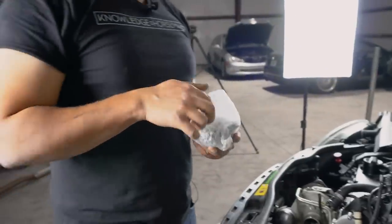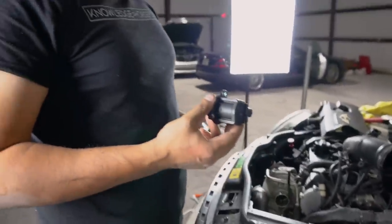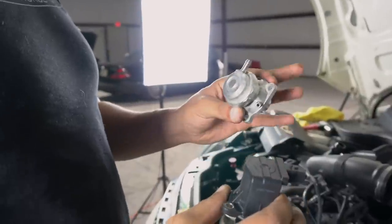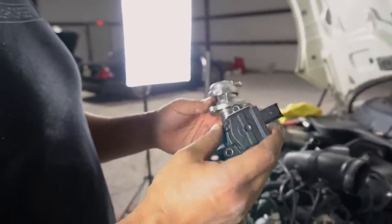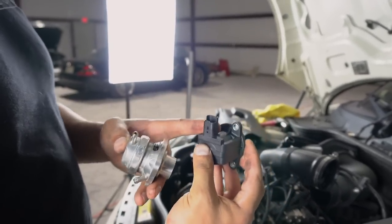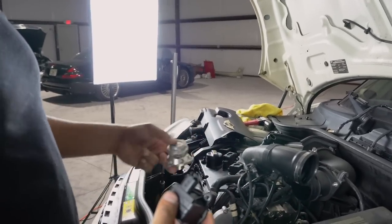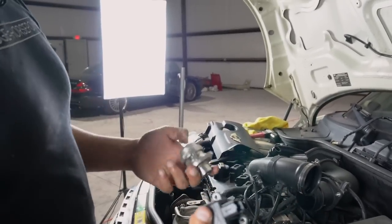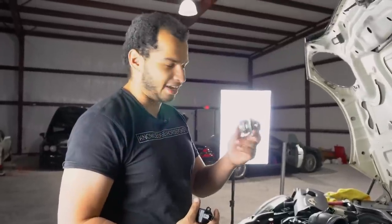Thank you, though. So here is a stock diverter valve. Diverter valve? Diverter. I still can't say it right. So stock diverter valve and stock forge performance? It's not stock. Well, okay, not stock. I've been inhaling a lot of fumes today. So it just goes like this, and then you have a little connector here, and that connects into one of the multitude of connectors. And this just diverts all the air back into the intake stream, and this diverts it to the atmosphere, and you get that nice sound.